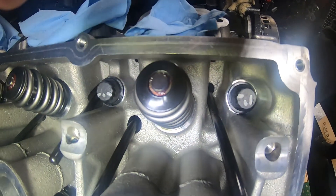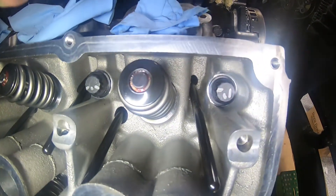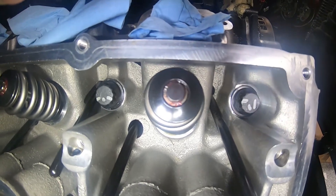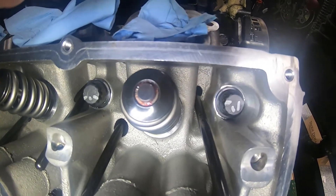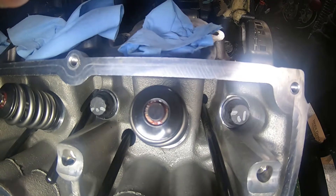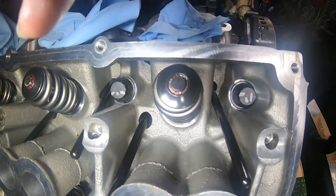Just to give you a shot: you can see the exhaust push rod attached to the rocker shaft, and the intake push rod we just put in. The exhaust ones go in the lower holes — slightly lower than their intake counterparts. Also, when pushing these push rods in, you'll feel them make contact with the lifter and often it'll push the lifter up against the cam lobe and kind of seat it. If you feel that, it's a good indication the push rod is where it needs to be as far as the lifter is concerned.